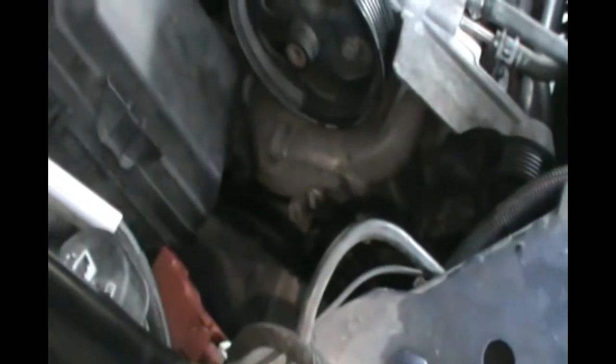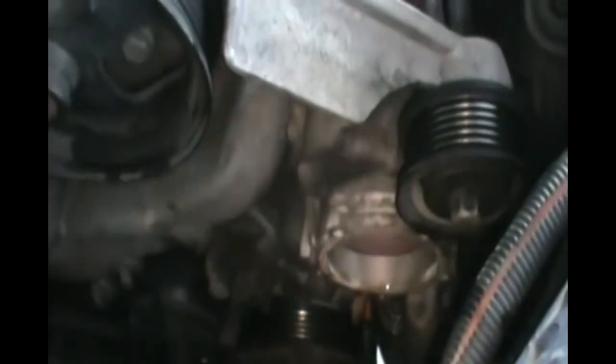And once that's done, then we go underneath, and we have to take this thing and try to lift it up and put it here. That's going to be a pain, but I'm going to show you a trick on how to do it. And that will retension the belt. And then put the tire back and you are done. Of course, don't forget to add coolant, because like I said, some coolant will fall off. Not much, but a little bit.